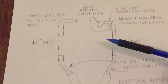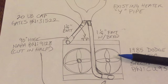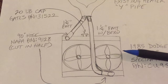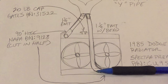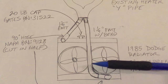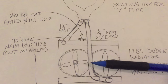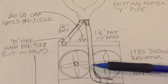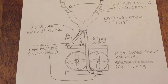These are just the stock Subaru radiator fans. They have plastic shrouds, so you can cut them pretty easily — I wouldn't use the metal ones with metal shrouds as they'd be really hard to cut and make work. This little pipe right here has a bend in it, so you need to be able to bend that, or get a radiator hose with a similar bend. Also, this pipe could potentially impact the fans, so you need to keep an eye on clearance — otherwise your fans will clip it. It needs to be tucked up nice and tight. Thanks for watching and we'll see you next time.